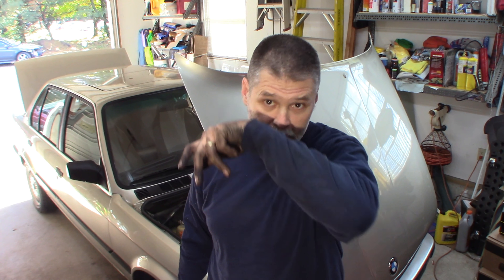Well, that's it. The alternator was fine. I always say — test, don't guess. You get a reading off the initial battery and it's not charging — just don't assume that it's the alternator that's bad, especially ever. This is a new replacement alternator, it's only been in there for a couple months. Doesn't mean that the new alternator is going to be good — sometimes you get that as well. But the problem was somebody didn't do their job. And you got to hear me go on a little bit of a rant — I try not to do that too much, but it's kind of a gift of mine.